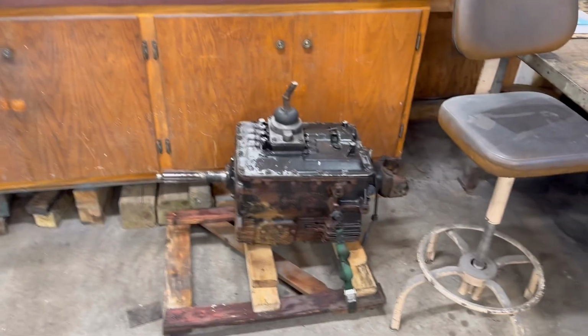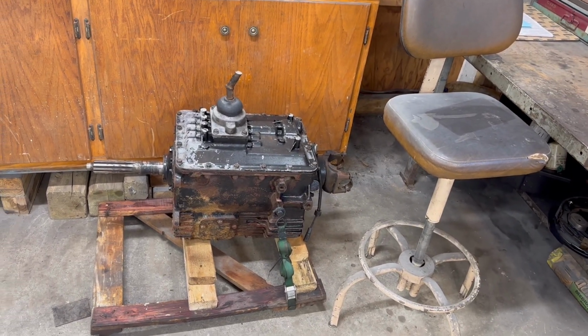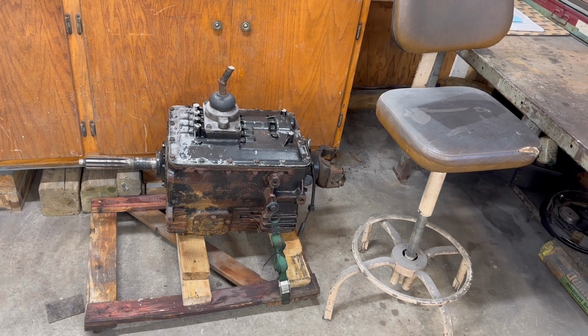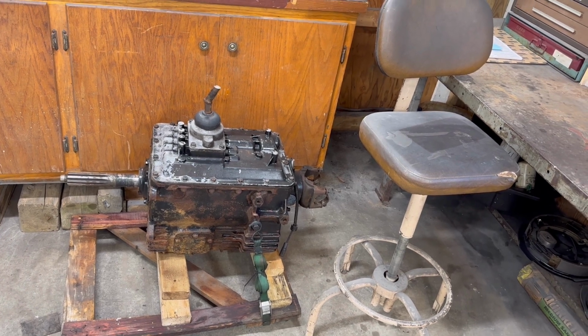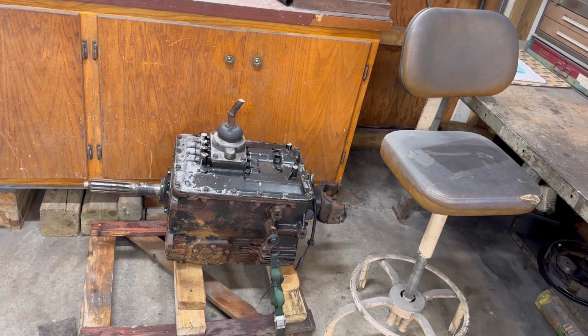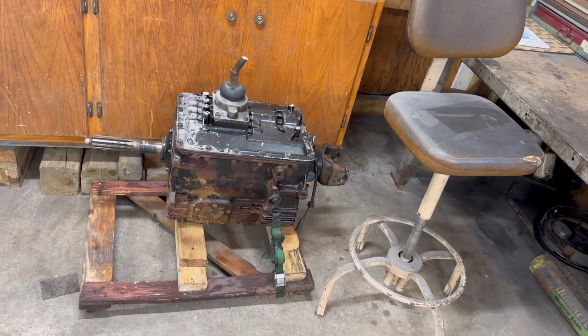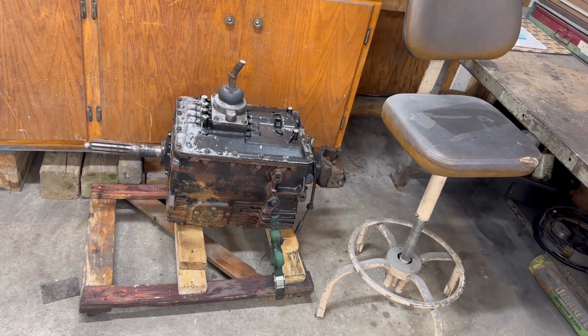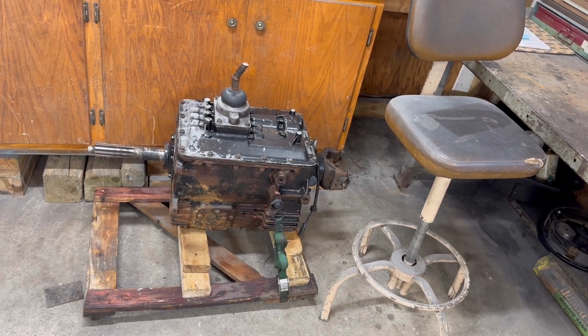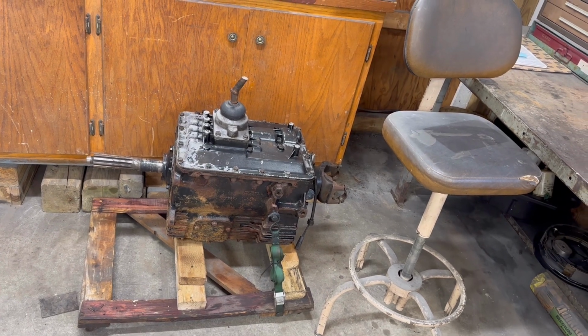Well, you saw I got the turbo. That's a WH1C, by the way, because this truck is a '94. In '95, that would have switched to the HX35 on a stick truck. Actually, I don't know, that was on the Dodge trucks. On the medium duty trucks, I don't know. They might have kept the WH1C for a little longer, but regardless, they're virtually identical to the HX35.